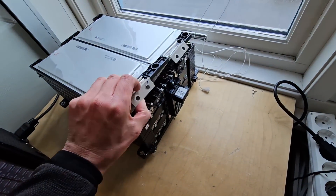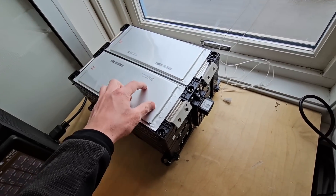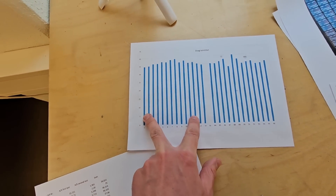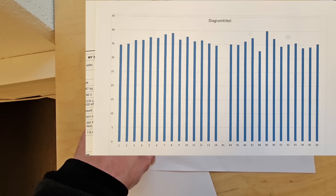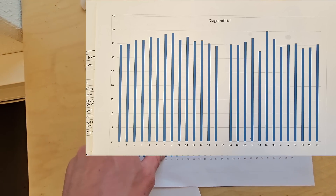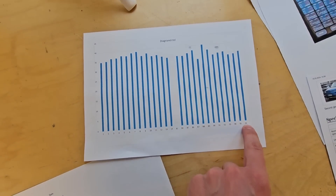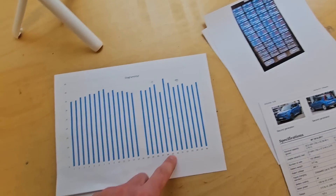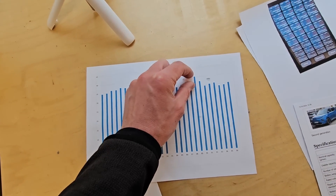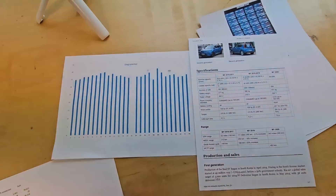As you can see, it's from one side and from another side. When I'm testing on the bench, I'm testing both cells at once from this side and from another side. So the readings here are from a double cell. And capacity, as you see, is more or less — not exactly the same, but there's not such a big difference. So let's say number one and number 96 are lower compared to, like I say, if you measure number eight or 89. But still, it's such a small difference that in my opinion it doesn't make so much difference.